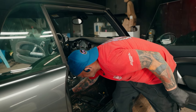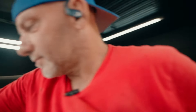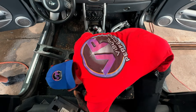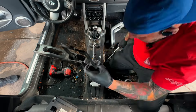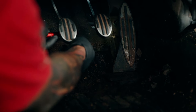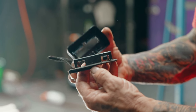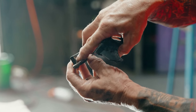Finding snakes, rats, spiders, maggots, and any other critter you can imagine are all too common when dealing with abandoned vehicles, and it is by far my least favorite part of the job. Now that the seats are out, it's on to the console, and this one's a bit tricky. BMW definitely don't want you taking this one apart with all the different size screws they used. With everything out, the only thing holding the carpet in was the accelerator pedal — and I broke it taking it out. But according to the Mini Cooper manual, this piece is meant to be replaced if it's removed, so I went ahead and ordered a new one.